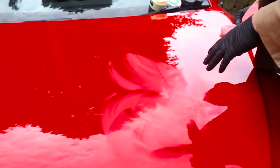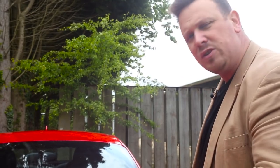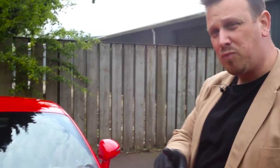But this area where I've applied it thickly, you'll find that although some areas will buff off okay, certain areas you'll be kind of spreading the wax around a little bit more. And there's a lot more drag on the cloth. By having a thin coat, it makes that buff process straightforward and easy. And you're not wasting product.